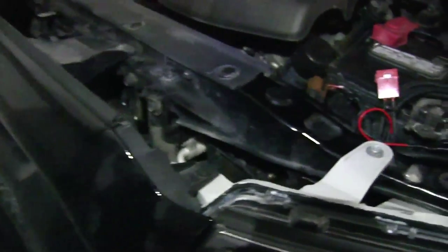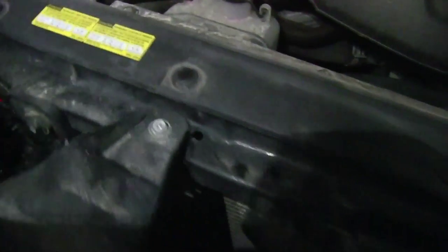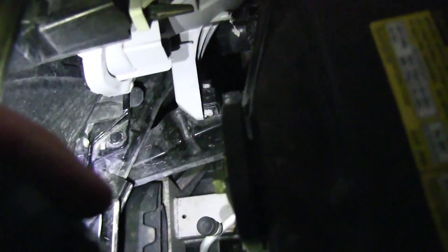The first thing you want to do is take off the grill. The grill is held on by four bolts — two actual bolts right here that are 10 millimeter hex heads, and then there's another one right there. This tab or little bolt, you'll simply pry it up with a flathead screwdriver and pull it out. There are also tabs on both sides that you'll pull up, and some tricky little tabs down below, right underneath the headlight. There are four of them and you'll just want to feel for those.